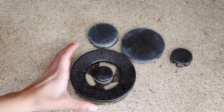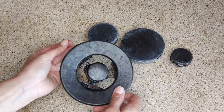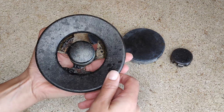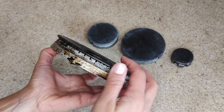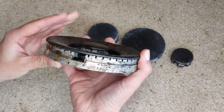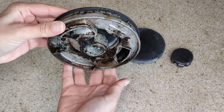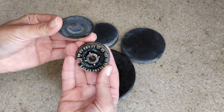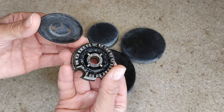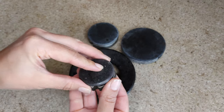This is the dirtiest gas burner I have. All this greasy coating appears during cooking, when something splashes or escapes to the stove. Also this burnt grease clogs the holes through which gas escapes. As a result, after the burner is switched on, the flame either burns unevenly or the flame is very weak.